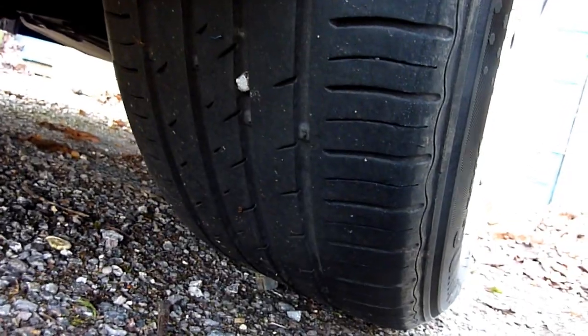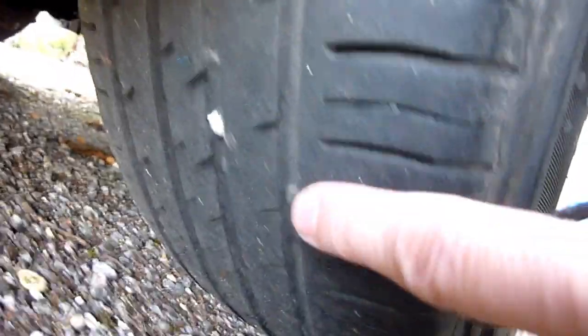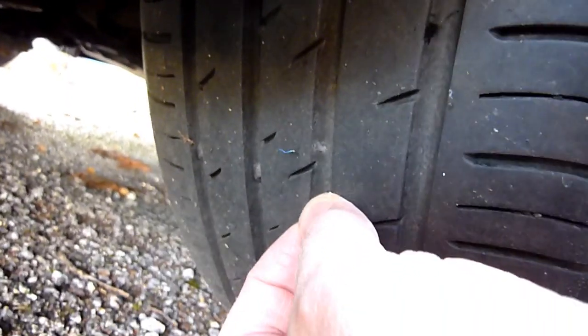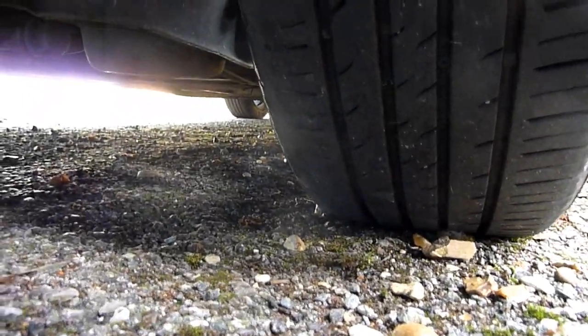A similar pattern on the other front tire — kind of even wear, a bit more tread on the inside, but this tire could be slightly near the limit. The rears are fine usually. Check tire pressure and look at the tread depth marker. If you see anything like nails, pull them out before they dig in and burst the tire. Really badly worn tires — worn on just one side — are a test failure.